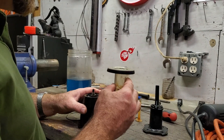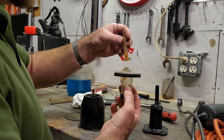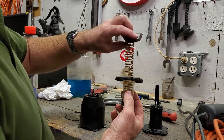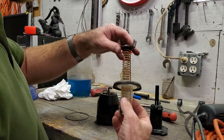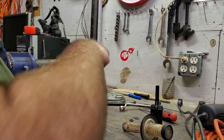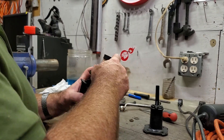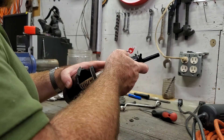The order in which it all goes back together is: piston assembly, stopper, the big spring, the little trivet-looking thing in the top, and then that all goes together. Normally what I'll do is put this in first, make sure it doesn't foul anything whilst it's in the bottom, line that up, and you need careful hands to do this. Push all of that down.